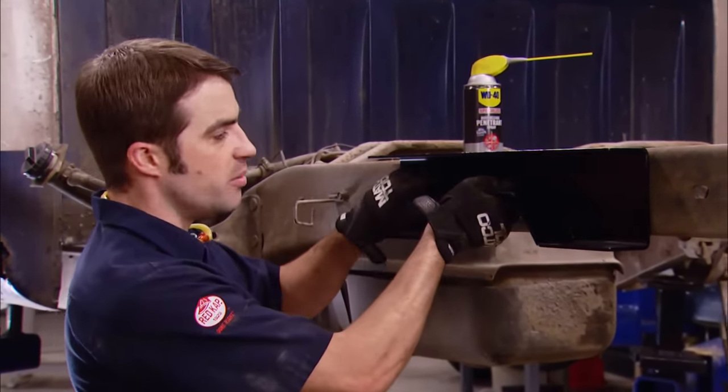You can see the location of the groove in the stock cap versus the replacement — it's in a different spot, and it's made to fit the replacement C-clip. To install the joint, carefully remove U-joint caps on either side and slide one half at a time of the U-joint into the yoke. With the U-joint cross protruding from the yoke, install one of the caps, making sure the needle bearings are all still in the correct position. Then flip the joint over and slightly tap on the yoke to make sure that the cap starts seating. Repeat the process on the other side, making sure that the needle bearings all stay in position. If one falls out and ends up in the bottom of the cap, you're never going to get the clips to seat, and the U-joint's going to fail prematurely.